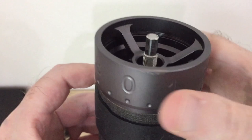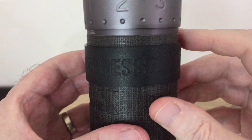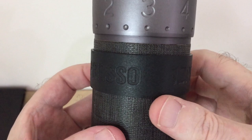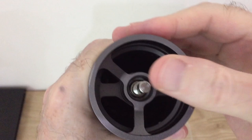You can see here where the point of impact is — this is where it's hit the floor and pushed the adjustment dial down a little bit. If I turn it, where it should be when it gets wider at this point, you can see it's narrower there and then it gets back to its correct height at the back. So it's been pushed down at an angle.